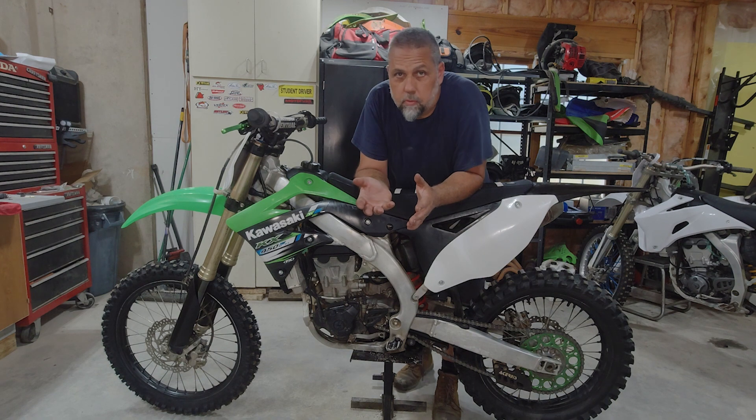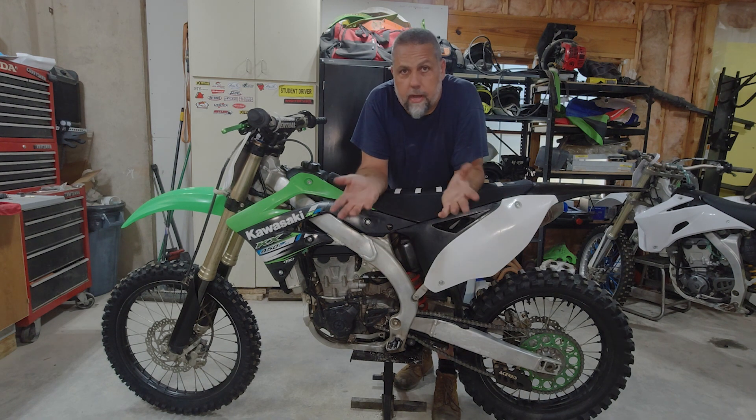Well, after all is said and done, this one didn't turn out to be too bad — ended up being a fuel pump issue. Whether it was the pump itself or the O-ring, it's fixed and it was fairly inexpensive. We went ahead and did a bunch of maintenance including levers, grips, brakes, chain, chain guide, air filter service, oil service, drain and clean the tank, new front tire, and more. This bike should be good and ready to run. As always, thank you all for your support and kind words — it means a lot to me. I'd certainly appreciate it if you could subscribe to my channel. Likes and comments all help get the word out, so again thank you guys so much for watching, appreciate you, and we'll see you on the next one.